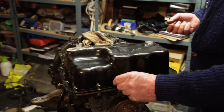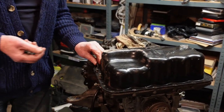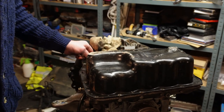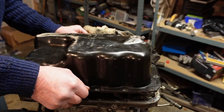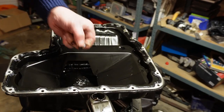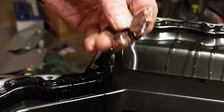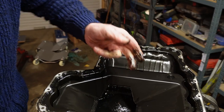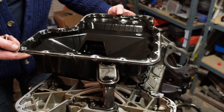This is the part where we find out where these engines fail. The cylinder heads, as I said before in another video, are fairly bulletproof — you don't get a lot going wrong with them. Obviously you can get manufacturing or assembly problems, but we'll take this off and the ladder rack as well. There's bits of metal — something's worn away. I wouldn't mind betting that's a main bearing, probably spun.